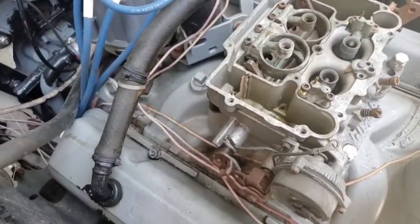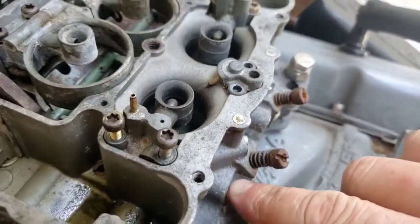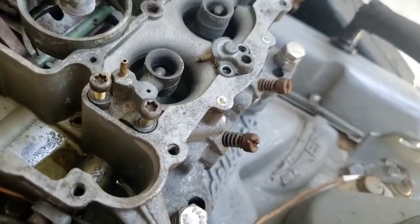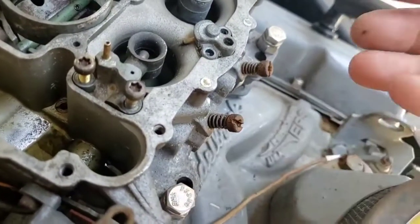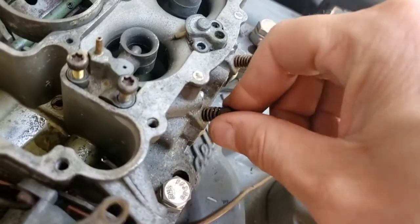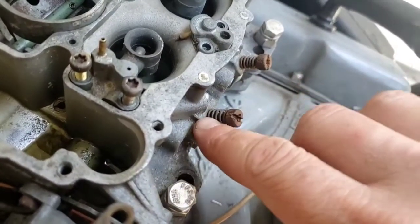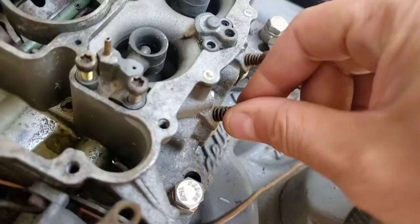The actual operation of this thing — the circuits. When you're idling, there's a little hole right below your throttle blade. Everything's closed, so the engine pistons are moving and sucking a lot of air into the intake. That vacuum gets sucked through this port, which is adjusted by the idle screw — it adjusts how much air and fuel goes through. It sucks from up here — that one to the right of my finger, it's like a half circle almost — and heads down that way.